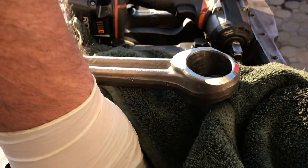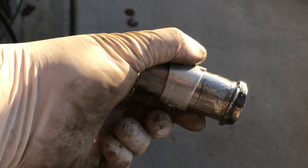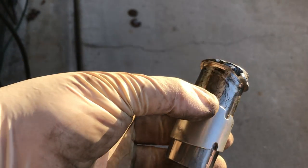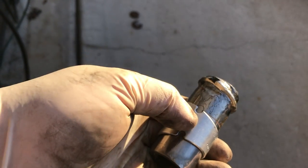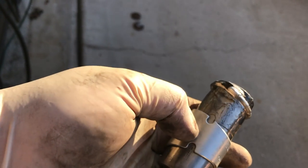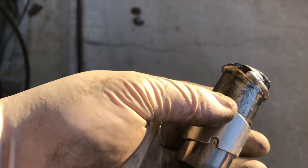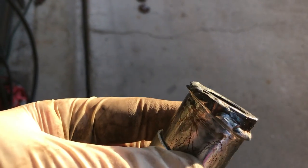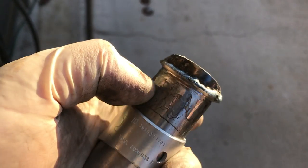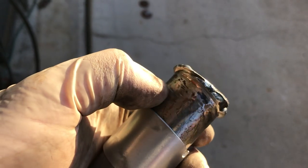The tapered end is an issue. What I've done is grabbed another wrist pin — an old one, the one that was actually wrecked. I just ground this whole thing down so it could slide in. The inside surface is going to get reground anyway to fit the new wrist pin, but because it's tapered, I had to basically create a very similar taper. Version 1.0 of this didn't go so hot.